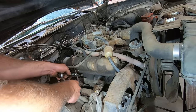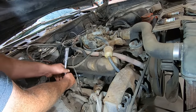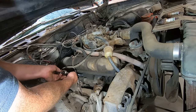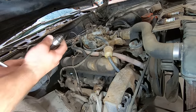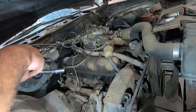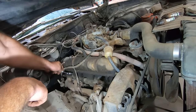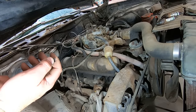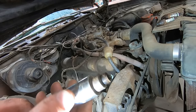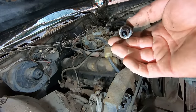Usually that sootiness on these cars, if they ran pretty long life, like this thing was 32 years old when they parked it, is it just kind of got idled around a bunch, in and out of buildings, on and off trailers, stuff like that. And runs real rich. And maybe just the carburetor was that poorly tuned. Oh, that one's got a little corrosion on her. So hopefully that doesn't mean a ton of moisture got in there. But usually that is what it means.